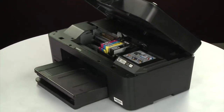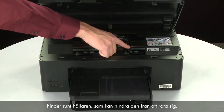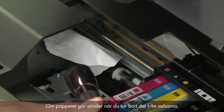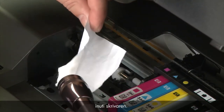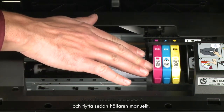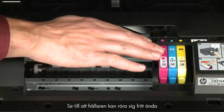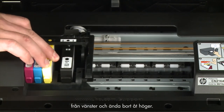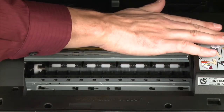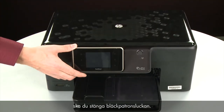Return to the front. Look inside the printer and check for paper or other obstructions around the carriage that could prevent it from moving. Use a flashlight for proper viewing. Remove any paper that is found. If the paper tears when you remove it from the rollers, check the rollers and wheels for torn pieces that might remain. Reach inside the printer through the cartridge access door and manually move the carriage, removing any obstructions found. Ensure the carriage moves freely from all the way to the left to all the way to the right. Once all obstructions are removed, close the cartridge access door.